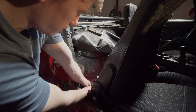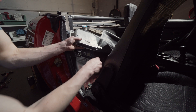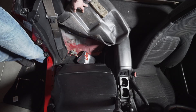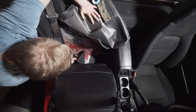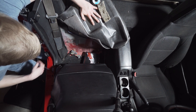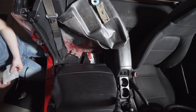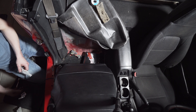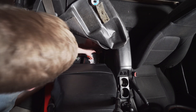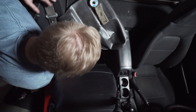Push down on this tab and then kind of pried it out like that. There's three connectors. Now we should be able to plug in our Mega Squirt. Since I'm afraid to drill holes into my beautiful car, I'm going to clean off the back plate and use 3M heavy duty hook and loop. Each strip holds 12 pounds and this ECU is nowhere near that heavy. That wants to mount right around there.